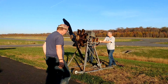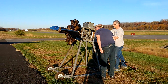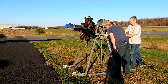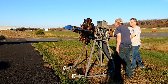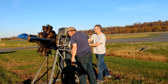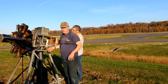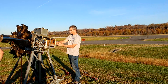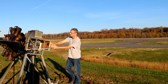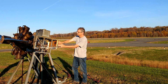Well, that's better. The other thing I don't understand is why do you have fuel in that overflow line if you're not getting fuel to the fuel pump? Well, obviously fuel is getting to the fuel pump some. The overflow line will fill to the level of the tank because it's basically a vent off the fuel pump. Okay, let's try that again.